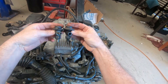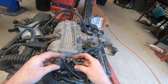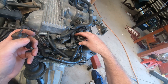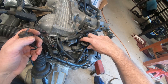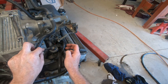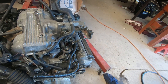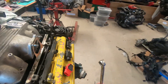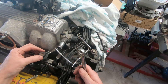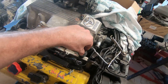Let's have a look here. It's the same concept — both have this locking nut that allows the fuel pressure regulator to be put into different rotational positions. We'll screw the Gen 1 one into the Gen 2 here — definitely the same thread. You put the vacuum line there; the outlet is in a funny spot but it does physically fit. And the Gen 2 one screws into the Gen 1 nicely too. If we put the vacuum line in the correct rotation, the outlet ends up in completely the wrong location.